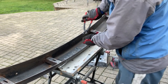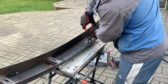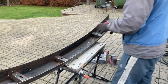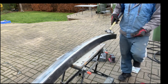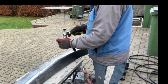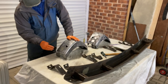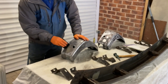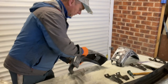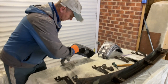They've got a couple of rivet heads just poking through where the number plate was riveted on, so I'm going to pop those out. I'll fill the holes as well and make sure they're all nicely filled. Then we can obviously drill what we need when we put the number plate back on again, but I want to just get it all nice and smooth. Whatever you do, don't miss that punch — watch your fingers. We're back under the carport and I'm just going to apply some of this filler to these bumpers to get them really nice and smooth. Any little imperfections, I'll just drop a bit of filler on there, and then we can sand that back and make these look really nice.